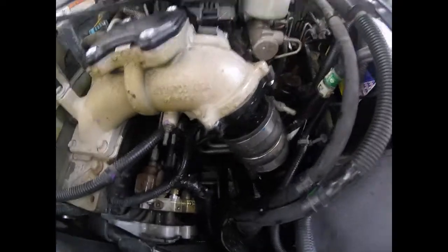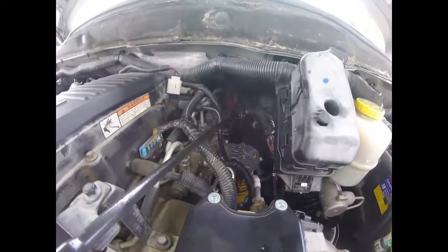When you go to start it, you just have to prime it a couple times to fill the filter up and then she'll start. Let me finish up these last couple things and then we'll go start her up. Just one last thing: when you do get everything bolted up, I would do just a simple rinse down to make sure you get any of that excess fuel out, because I know these trucks are kind of known for lighting on fire. I'd rather not take the chance, so just rinse everything down.